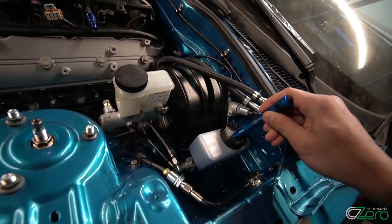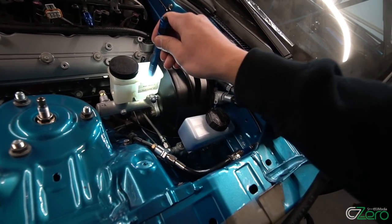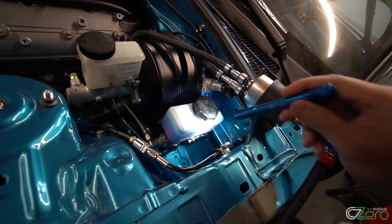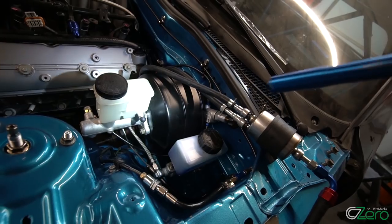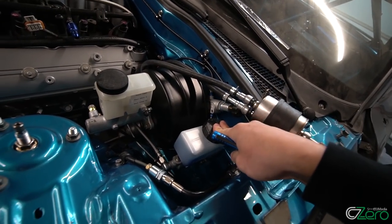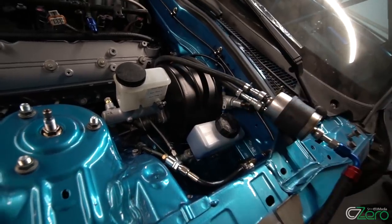On the clutch: in the previous video I had this line hooked up to the brake line, which is how the previous owner had it routed. I realized that's not a good idea because if it gets dirty — which it does — the brake reservoir would get dirty too, making the brake lines dirty. So what I decided to do was get a separate reservoir for the clutch and a separate one for the brakes. So now it's two separate systems.